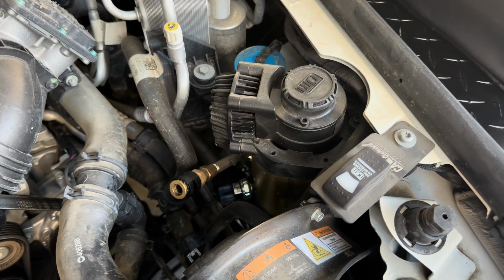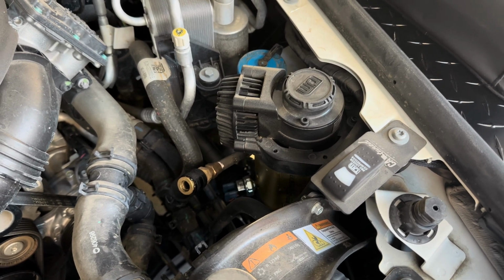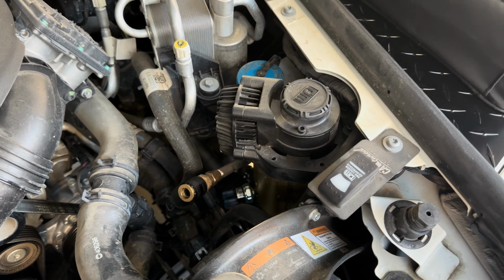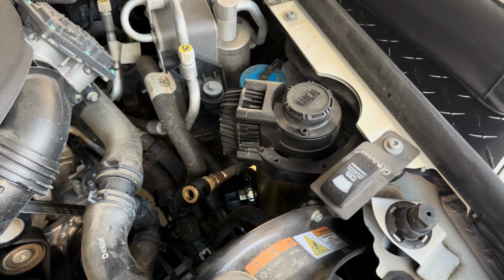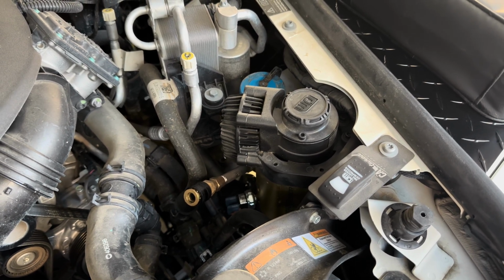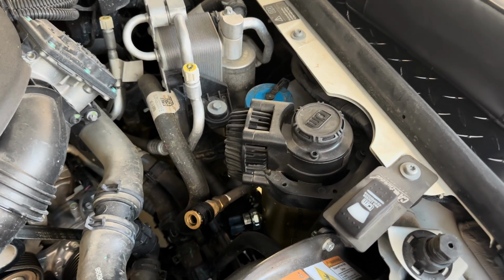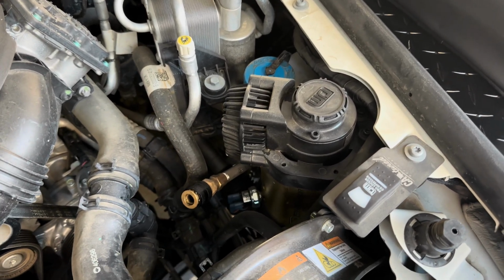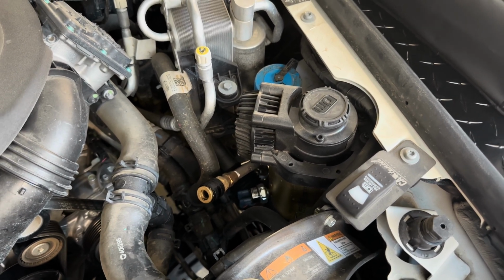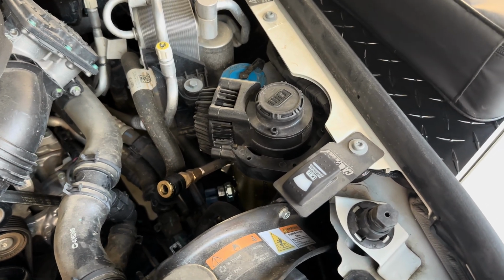It's also useful in my case because I already have the lockers. The Grenadier has front and rear Eaton E-lockers, so it doesn't need air, but a lot of people run ARBs and they work off of a compressor. Since I don't have that, I don't really need the twin compressor or to run two separate single compressors, one for onboard air and one for lockers. So this is a nice option.